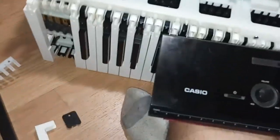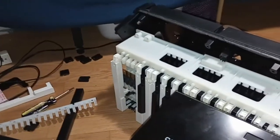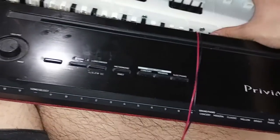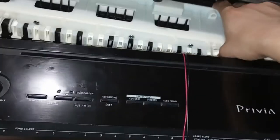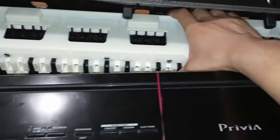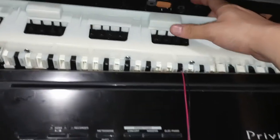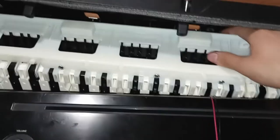Now you should work on the floor. It's actually easier if you tilt the entire unit — kind of have the front of it standing up, sort of like that. Drape the speakers and this main unit over your lap. Then hold this white assembly together with one hand — this is where most of the piano is. Just firmly grasp it, then push the back piece off and it will fall off.